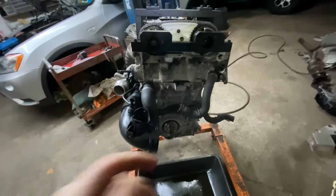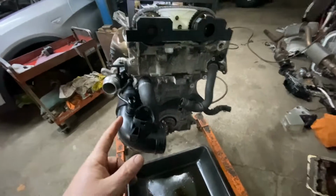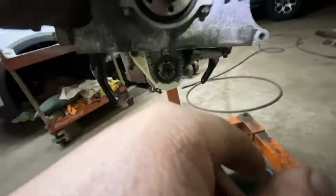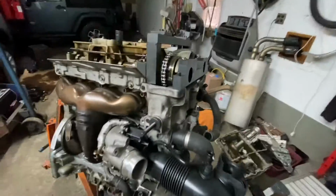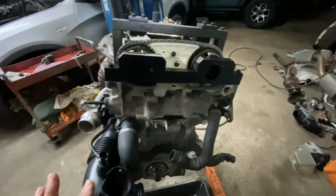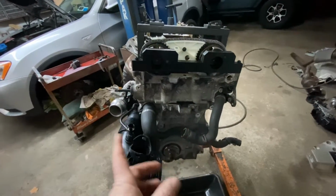All right. Okay. So once you've got the bottom bolt tightened and your top cam bolts tightened, the special tool is still in here, hand tight, as much as you can tighten it by hand. That's still in there. The oil pump tensioner is released and has pressure on the chain, and you still have your counterbalance lock in there. Okay. So now you're going to take the special tool out over here and install the tensioner. And then after that, you're going to take everything off. All the locks, all the tools, and you're going to spin the engine clockwise 2 revolutions,